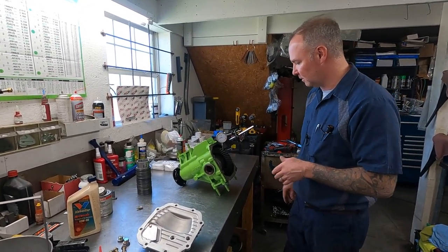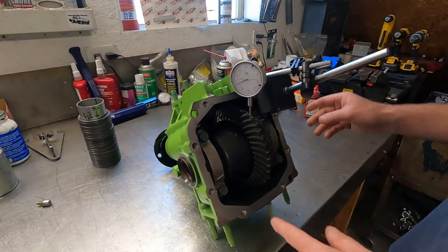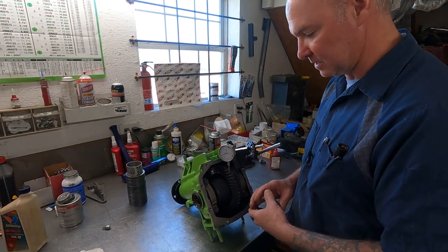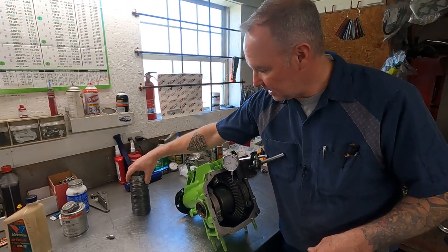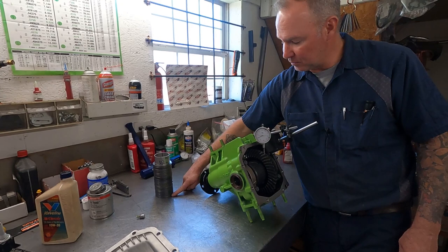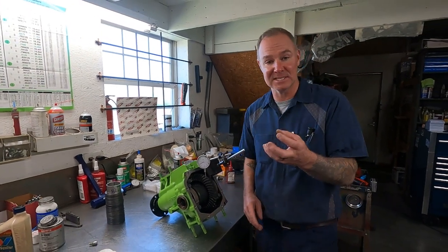To adjust your backlash, you have shims on either side of the differential that go between the cap and the bearing — between the outer shell of the differential and the bearing — and it does two things. Not only does it set your backlash, but it also sets your bearing preload. These shims range from fairly thin to pretty thick, and there's only about two to three thousandths difference between each one. But if you don't have these, you cannot get your backlash and your bearing preload right — very, very important part of building this style of differential.